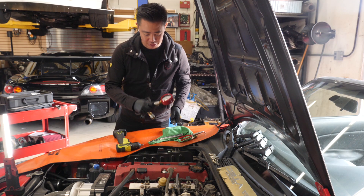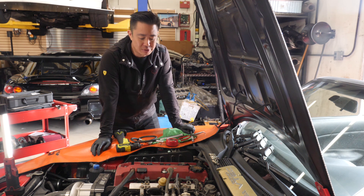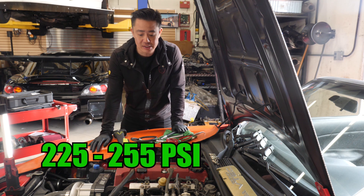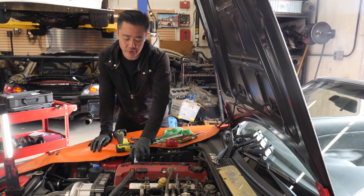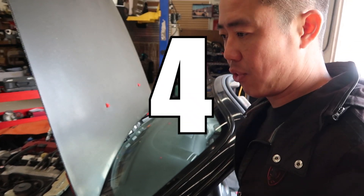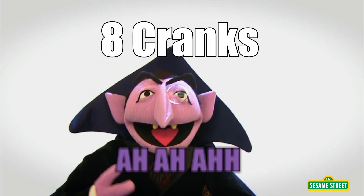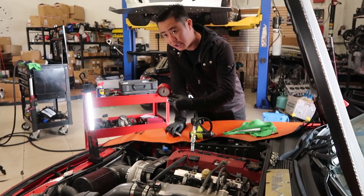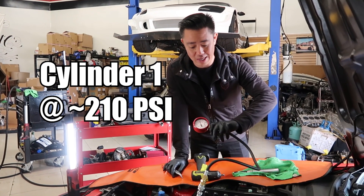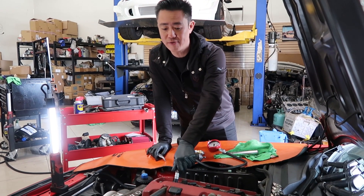This is our Snap-on compression gauge. What I'm gonna do is crank the motor over about eight times. I want to see anywhere between 225 to 255 PSI on eight cranks — closed throttle, no oil, all dry. Our reading is about 210, a little under 210. Not too bad, but not exactly where we wanted it. We wanted between 225 and 255.